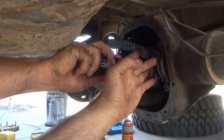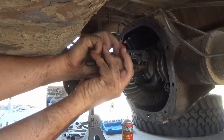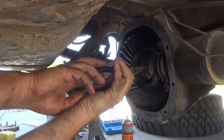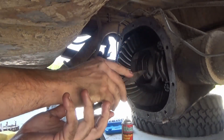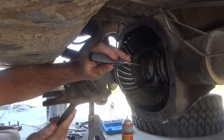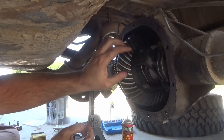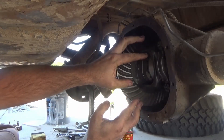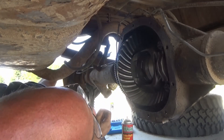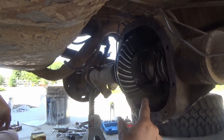Here you can see I'm using two pocket knives to spread the inner and outer couplings apart so I have room to put the c-clip in place. It's a little tricky to get that c-clip in because you have to line the axle shaft up exactly with that groove, but once the c-clip has started I pull out the knives — being careful not to cut myself horribly and ruin this video. Once those are out I let the inner and outer couplings snap together, then use a screwdriver to tap on the back just to drive the c-clip into place. Then I rotate the axle so everything meshes back into place, making sure everything meshes before going on to the next step.